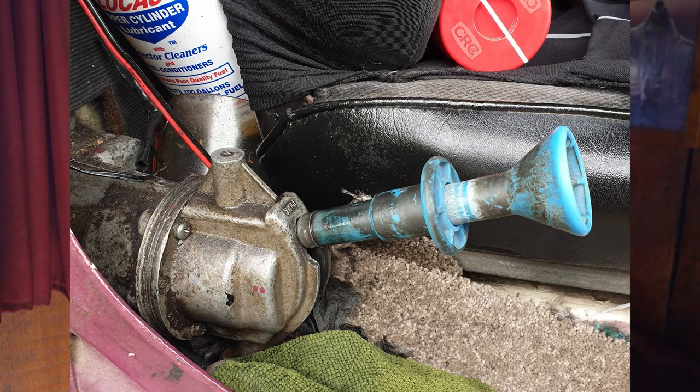In this truck if you haven't got any air you don't move — the brakes are locked on — so I knew that end was working and there was something further up. I hoped the valve was just stuck and sprayed some CRC in it and tapped it, because it has got stuck before and stuck open, actually, draining the air. But nothing was working so I posted on Facebook and it evolved from there.